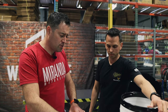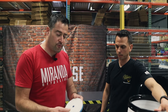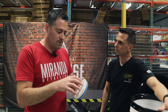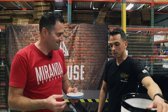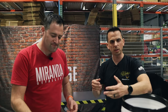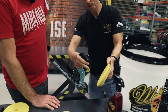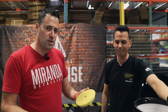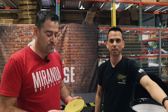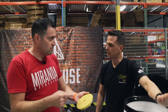It seems to help with dusting tremendously, and with lubrication if you're using heavy cutting compounds. If you're using microfiber discs there's a lot of heat, a lot of product building up and friction that creates dust and dries out quickly. The pad conditioner adds lubrication — besides making it easier to clean, it reduces buffer heat, which is usually an issue for beginners or if you're working on a boat removing a lot of material. It helps with a smoother buffing experience. One bottle will last you forever because all you're doing is a couple of mists — priming your pad. No more having to use all of your compound or polish the old way of priming. You can do this even as you're polishing the vehicle — clean your pad on the fly, do another mist, put more product on, and keep going.